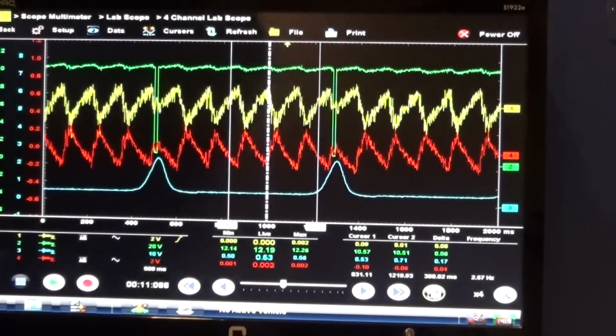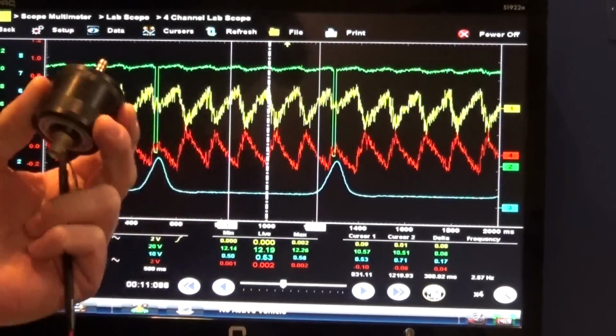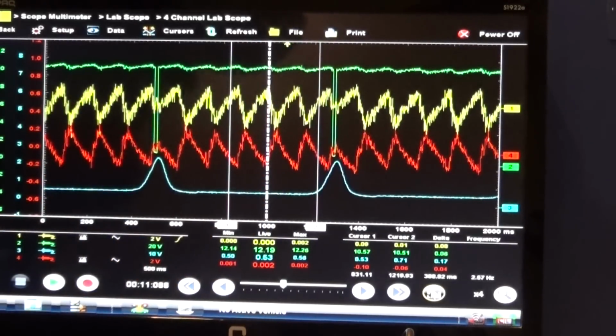So we covered a high current clamp, low current clamp, voltage drop and how they relate to each other, and my next test I'm going to use a first look sensor. I'm going to set all that up, and then I'm going to use this guy to do a relative compression test. Instead of reading any current, it senses pulses in the exhaust, when the engine cranks and it sucks the air and pushes the air out into the exhaust.